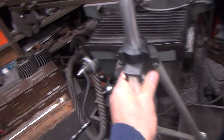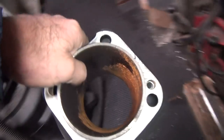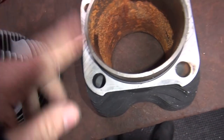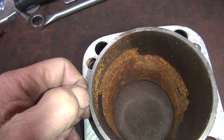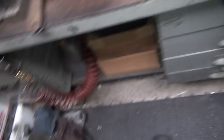So this video is going to have a twin cam cylinder bore job. These are some takeoff cylinders somebody left outside - got a little rust on them. Some people think those are junk, and they would be junk if you didn't bore them. But we're gonna bore them. Now these are 88 inch twin cams. See how thin the sleeve is on a stock cylinder.